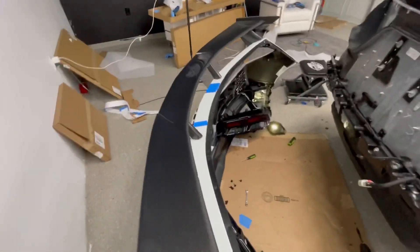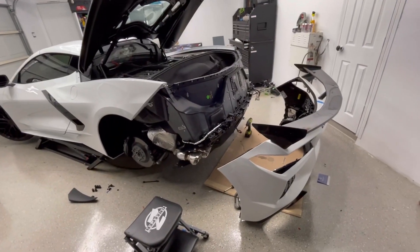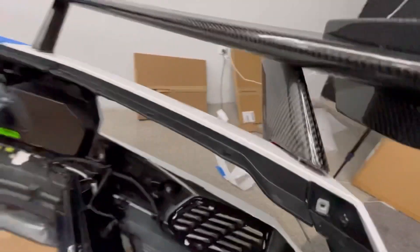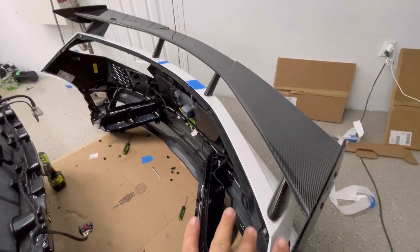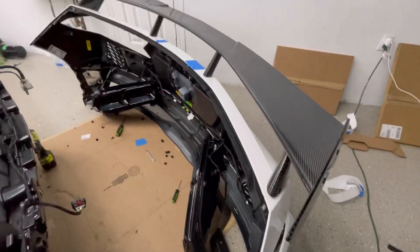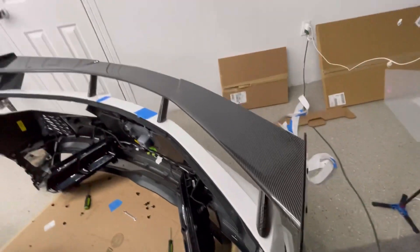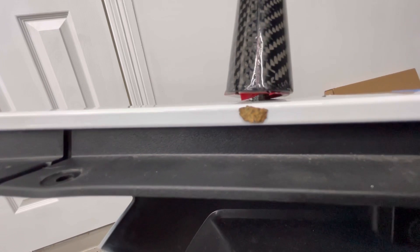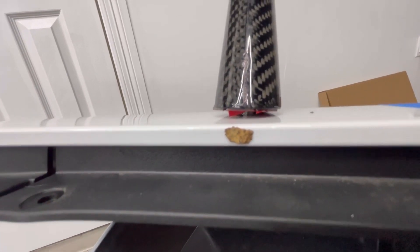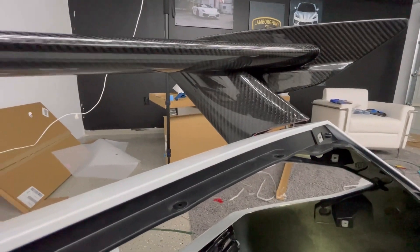So I got the bumper out — it was fairly easy to do. What I did first is I fit the screws in — before you tie them in all the way, you test all of them to make sure they fit in the holes, and then you screw them all the way in the position they're going to be at. I actually put some 3M glue or 3M double tape here, so now I'm going to peel it out. I didn't want to peel it out before because once they touch the surface they're going to stick to, it's pretty hard to get them off.